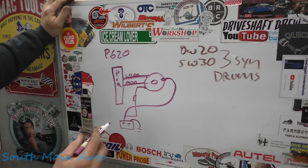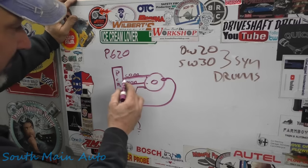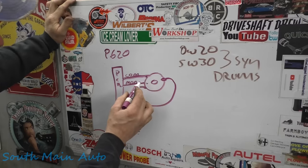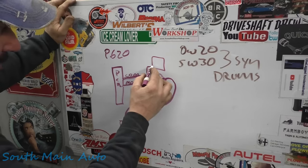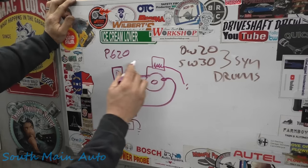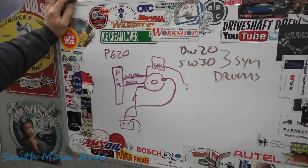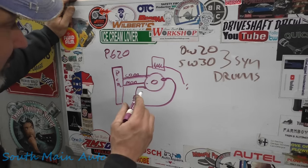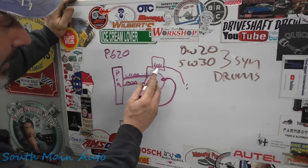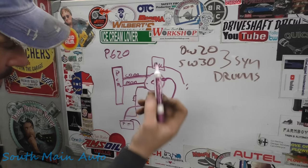The GenComm, with the engine running, was supposed to be at 69% duty cycle. So we probed into it and used our scope. We had 69% duty cycle, but it was only about 2 volts, which is wrong — it should be higher than that. I want to say these run on 12, but this may be 5. Either way, we only had 2 volts but a 69% duty cycle.